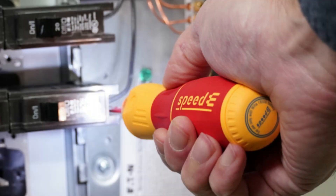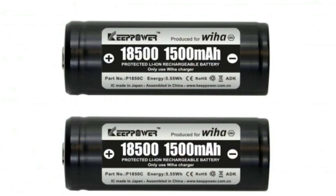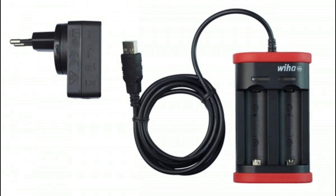There are a lot of little extras that make it extra fancy for an electric screwdriver. It's got a nice ring light, and the ring light also lets you know when the battery's low — it pulses on and off. It's powered by lithium-ion batteries and comes with two batteries, which is really nice because you use one and charge the other. They're 18500 size — a standard size battery — but what I like is these are protected cells. EE Power is the company. Don't use unprotected cells. They're 1500 milliamp hours. You also get a charger — a USB wall adapter with universal plugs. Mine came with a couple of different plugs including US. You can also power the lithium-ion charger over USB, so you can plug into your computer or a USB outlet.